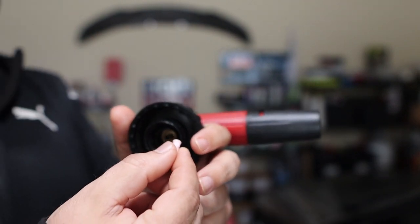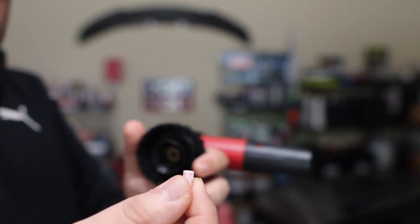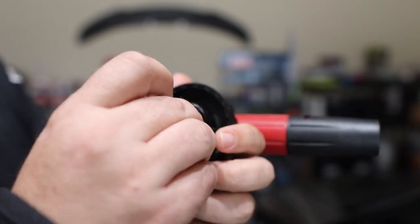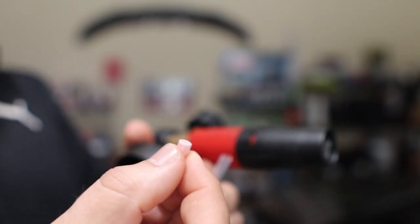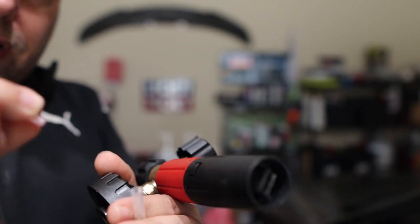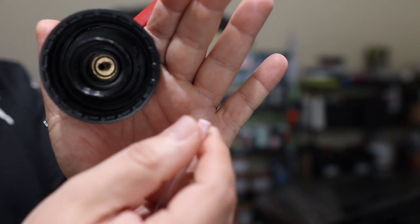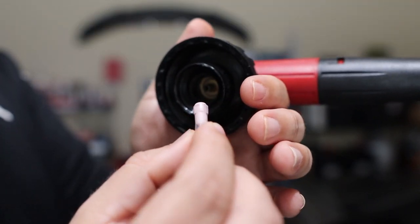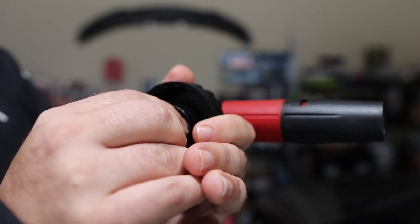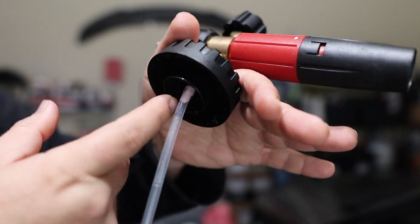I'm using a pink tip in this one because I don't want to have to switch the tips back and forth. I'm going to use all three colors — blue and pink. I believe pink is made for gas pressure washers, so this may foam slightly different. Since this tip is pretty recessed in there and it's much larger than the Brilliant Finish, you can't fit this over. So really you can do this either way. I prefer to stuff it in the tube — it's also easier to get it out by pinching it. You just get the tube right at the top and use the tube to force around that tip, making sure the tube goes all the way to the end. And there we go — we have our metered tip within the siphon tube.